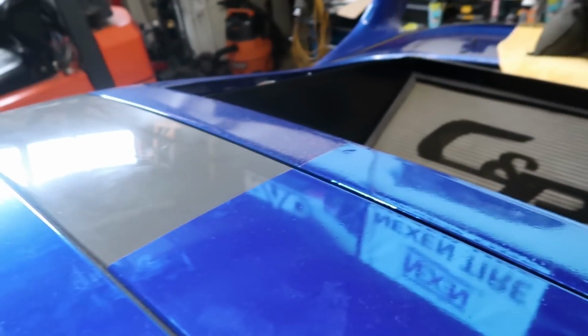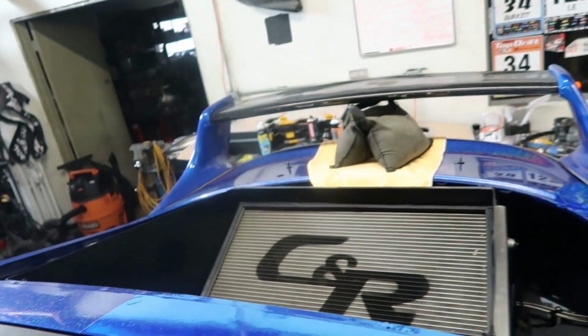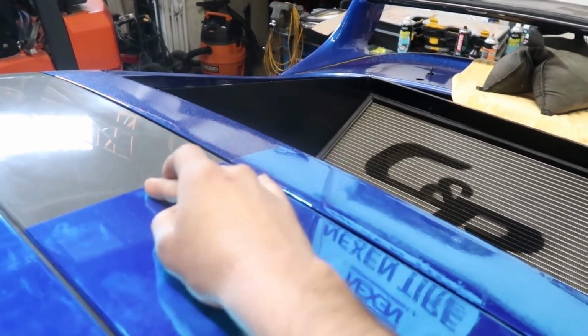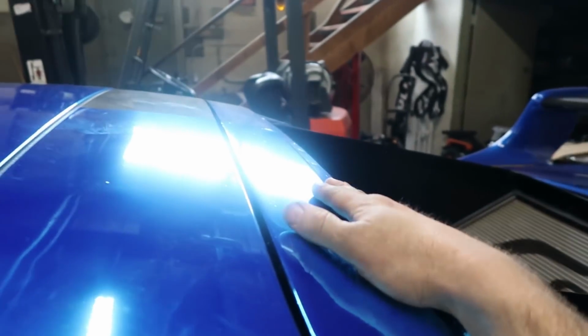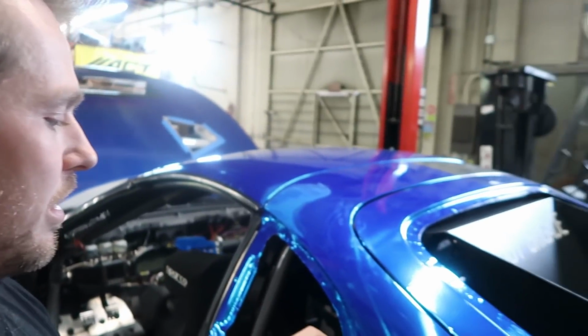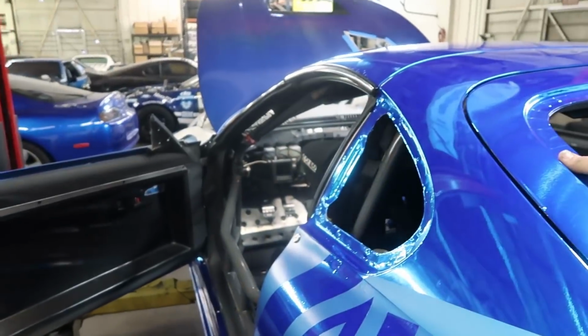I used to have the antenna wired up right through this hole here. If you can see that one, we wrapped over it, but then it makes it quite difficult when you bend the hatch and you have to put a new hatch on, which happens in drifting because you'll bump the back corner. So now I'm gonna drill a hole here, and then it's just part of the chassis. It'll pretty much be the same look, but if I have to switch the rear hatch, or if I happen to go to a carbon one, that would not be in the way. The only thing that will be in the way is the string of wire that will go this way to the third brake light, and that'll be the last one, so then I can just have an easy way to disconnect it.